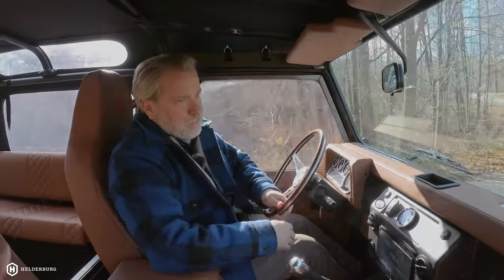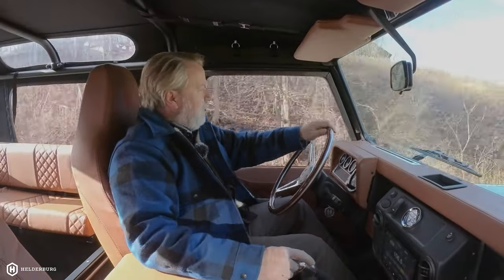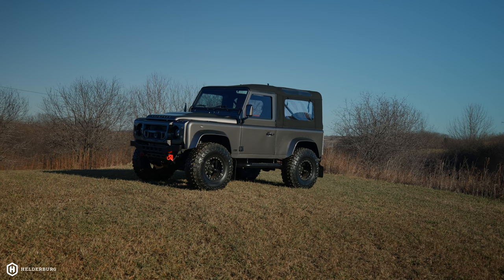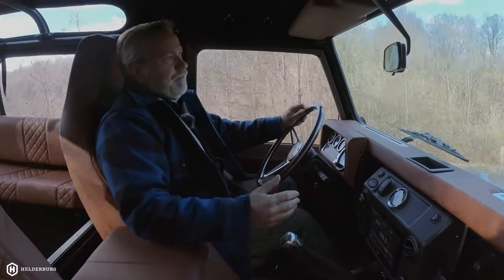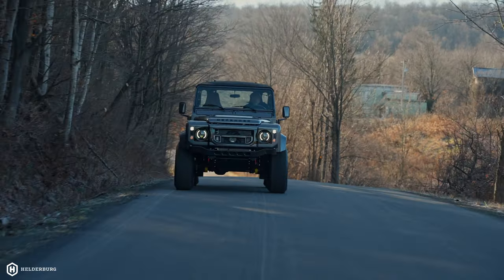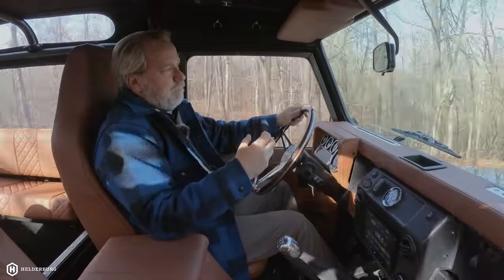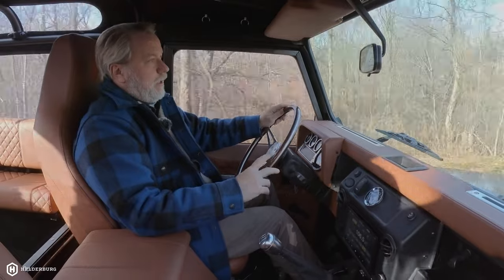Highway speeds are not an issue — that's the drivetrain. This one's been lifted; we put about a three-inch suspension lift. Anytime we do a lift, we do it properly. It's not a body lift, it's a suspension lift. That requires a heavy-duty prop shaft, heavy-duty transmission, and you have to change out the radius arms. You've got to do a three-degree radius arm, because when you lift it you're twisting the axle, making parts bind and wear out. Changing the radius arm puts the geometry back the way it should be.